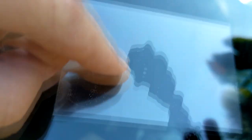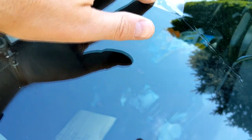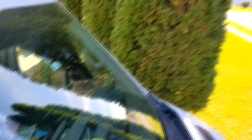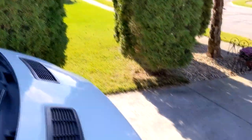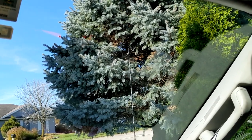This little dot here - I don't know if it's visible - but the air is actually outside so I'm not worried about it. This little dot right here is the chip I have. At this point they recommend putting the windshield in direct sun, and as you can see I'm a little bit in the shadow, so I'm gonna drive forward a little bit. I moved it into direct sun - in the sun the drying time is approximately five to ten minutes.